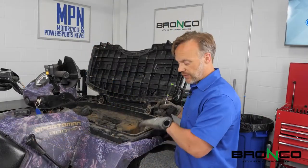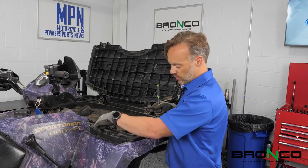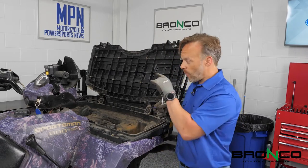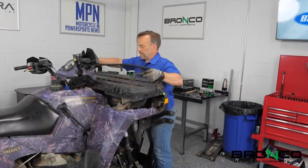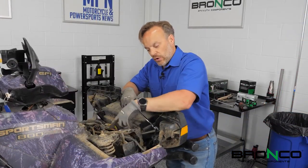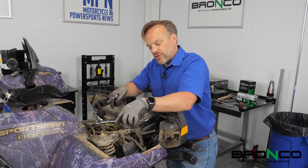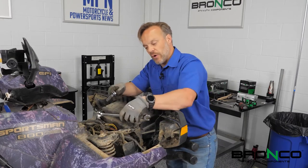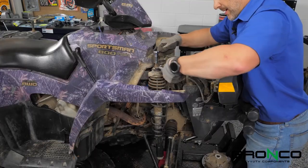Now that we've got the spindle assembly off, the shock and strut assembly along with this spring is what we're going for. In order to get the top end off, we've got to take the rack off — we'll get to that next. When you take this off, you've also got to be aware that there are four small T25 Torx screws — one here, one here, one underneath here, and one back here. Get all four on each side and this will lift right out. The last piece: we've got to hold the shock shaft straight while we loosen this lock nut. If you just try and turn the nut, the whole assembly is going to spin. So we hold the shaft, spin the nut, get that out, it'll drop down, and we can start putting it back together.